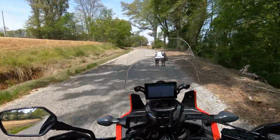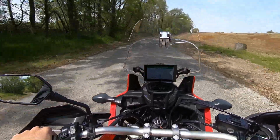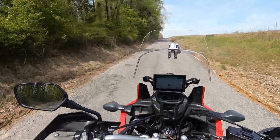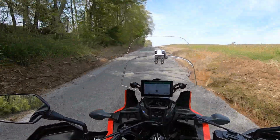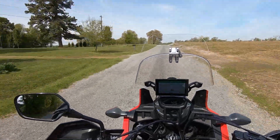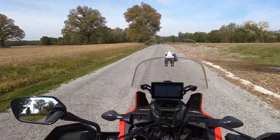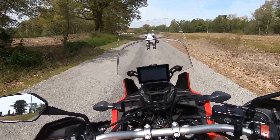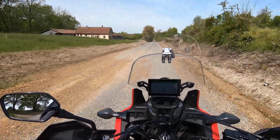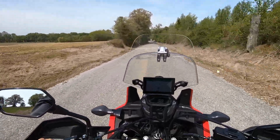Suspension, I've played around with it, and if you ain't careful, you can really mess up the ride. Because I tried messing with it to cut down on the fork dive, adjusting the rebound and the compression and all that stuff, and you can fix it where it doesn't really fork dive, but then when I had it like that, it made the steering feel a little vague in the corners and stuff, and I didn't really like that.